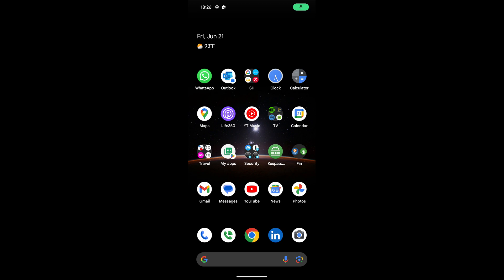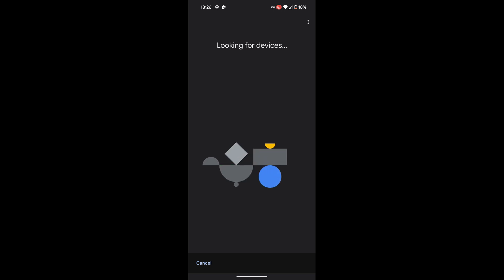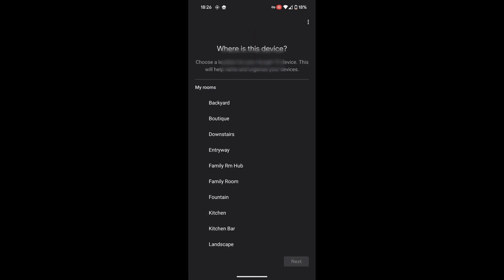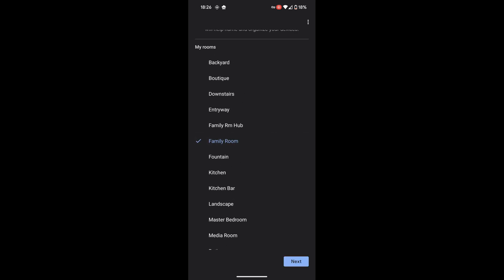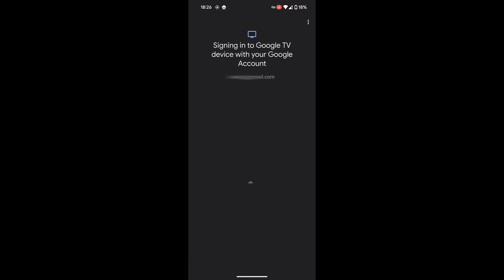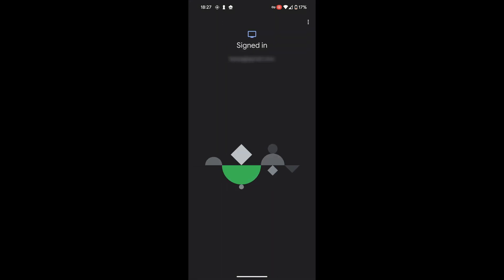I'm opening up my camera app to scan the QR code, pointing it at the code. It pops up the URL — I click on it and it goes to the Google Home app. It's scanning for this device and should find it since it's on the same network as my phone. There we go — it's finding it, connected to the Onn Pro. It senses it's an ethernet connection. I click next, accept some conditions, and then it asks where I want to put this device, so I'll put it in my family room. It's going to attempt to connect and transfer over my account credentials.